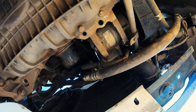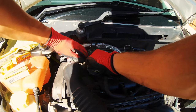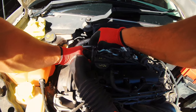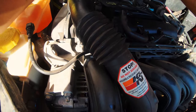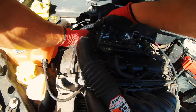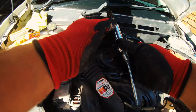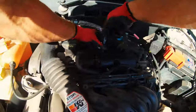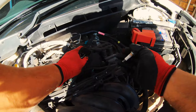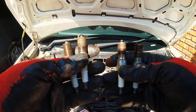Just make sure your bucket is positioned and you don't spill the oil. So you're going to pop in your spark plug tool and give her a good old twist. That one is a bit loose. I always like taking out all four and inspecting them just to see what they all look like. I'm not skipping the time for unbolting the spark plugs. And out she goes — number four. So let's just take a side by side comparison of all four. They've had their miles, definitely due to be changed.